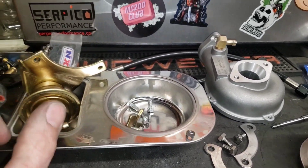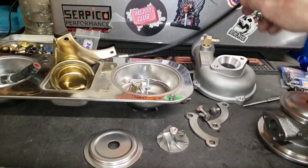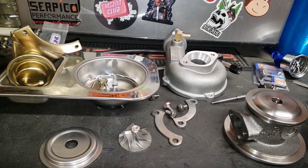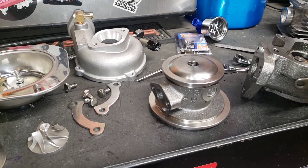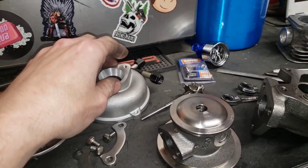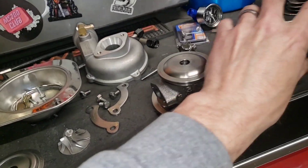Get rid of them. I got all my little fittings — all these little 1/8 inch NPT to 3AN — and I'm used to that from the nitrous stuff now. I'm gonna run all this quick braided line, the 3AN stuff, just cause I'm gonna have this damn thing apart 57,000 times, so make it easy. These quick swivel connections just make it easier. I'm gonna use gasket maker — just put gaskets in where I think they should be. I don't think it's really necessary on the cold side, but on the hot side, I do have a gasket set with it. I think I'm gonna use gasket maker and make a gasket in here.